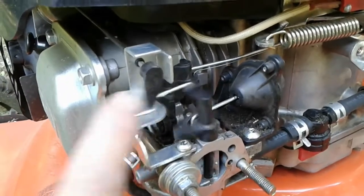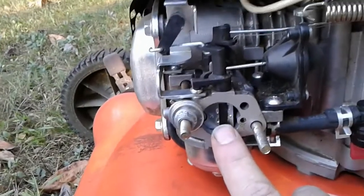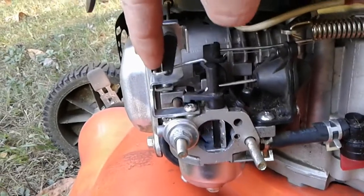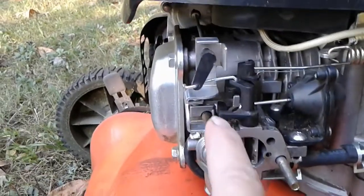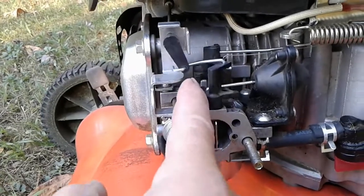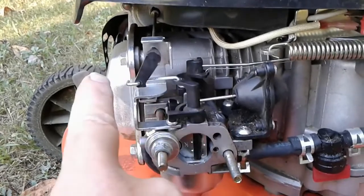What I found on this one was that this mechanism was all very stiff. The engine is completely cold, and when it's cold like this the choke plate should be closed so you can start it up cold, and then within a few minutes it warms up and the choke plate opens. That was not happening — the choke plate was pretty much shut and not opening. So I lubricated the shaft of this choke plate and played around with this linkage.